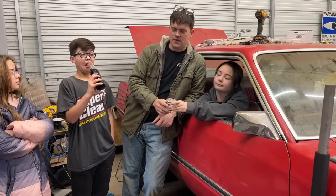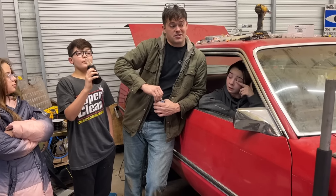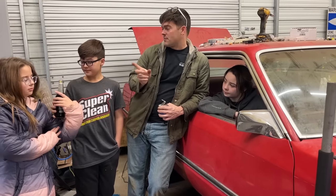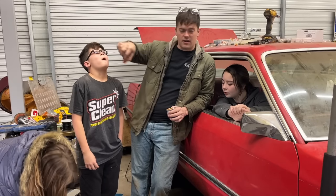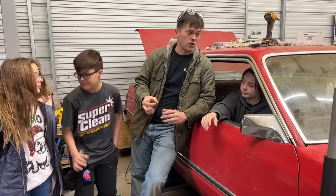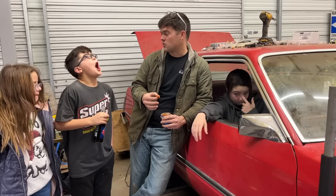Exactly. I'm hoping this thing will run good when we get it all together. Really, the engine, we just gotta take the engine back out, bolt the oil pan on good. We gotta do our oil drain backs for our turbo. That is something we gotta do when we have it out. That shouldn't be too hard to do. We're shooting for somewhere, it ought to be making over 500 on motor, and under boost, non-intercooled, probably in the little over 1,000 horsepower range.